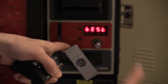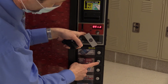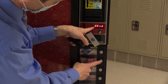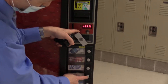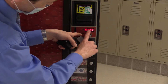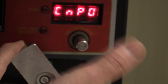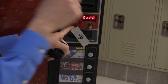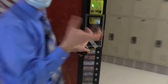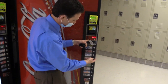To enter that, I'm going to press the fourth button. You have different tests that you can do in your machine — we want to go to the relay test. Keep going up until we see relay — and there it is. Press the fourth button to enter. Now this is the compressor relay. Right now we see a zero at the end, which means the relay is turned off, so the compressor should be off. If I press the fourth button, it should turn that zero to a one and turn on the relay for the compressor. You'll hear the click of the relay and then the compressor come on. Let's give it a try.